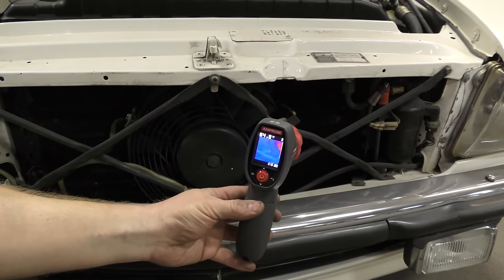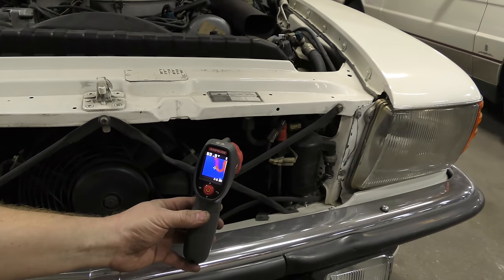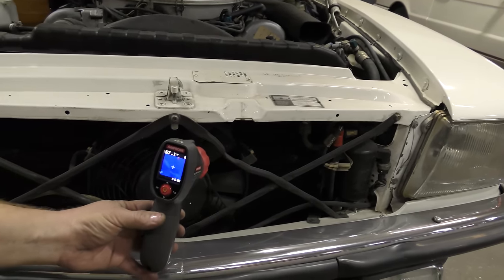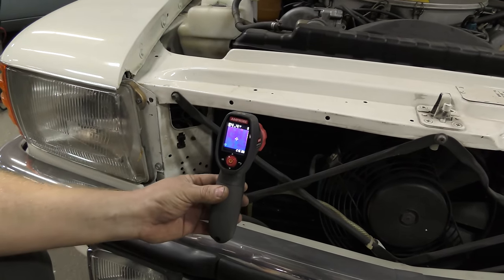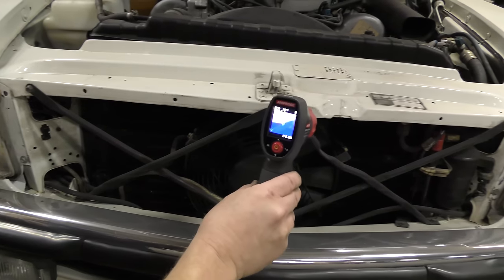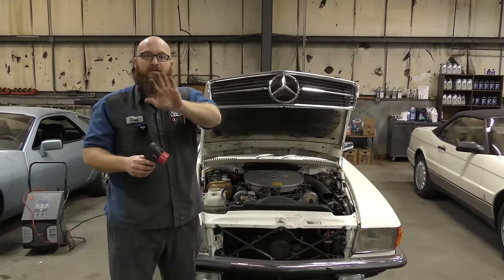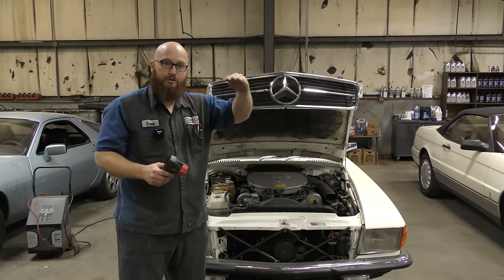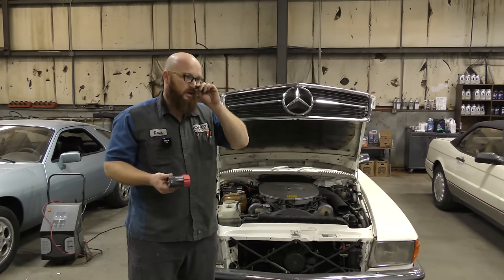When your AC is on, you're not looking for cold lines — you're looking for hot. The condenser gets hot; it takes the heat out of the Freon. We can see the high side line is orange — that's hot Freon — going into the condenser. Look at that orange scattering, that's the heat that's actually in the condenser. On a hot day, you would like to see that orange color across the whole condenser. But if you get to an area where it's blue, you know it's plugged. Using this tool, I was able to look at the condenser and see it had a nice orange pattern across the entire condenser — I know that it's a good condenser. If the bottom section was still cold, then I know it's plugged, and I'd start asking why — has it been damaged, or is the compressor damaged?